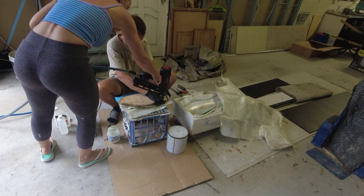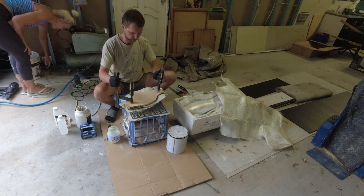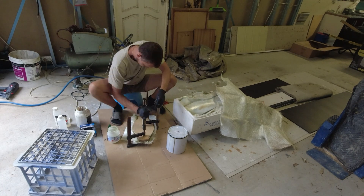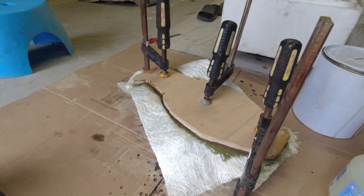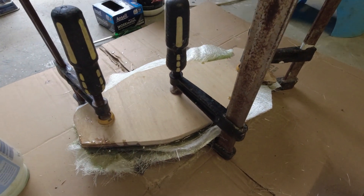Now we're putting a few little tack nails at either end so that the three laminated pieces don't move around on each other when they get clamped together. Clamping the job together like this is a crucial part of the laminating process — this ensures that most of the resin is squeezed out through the sides and we will have a beautifully laminated plug with no dry spots inside.